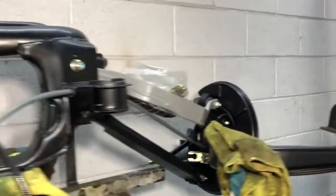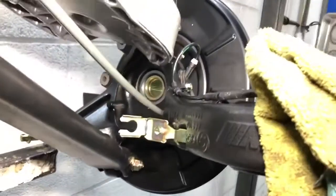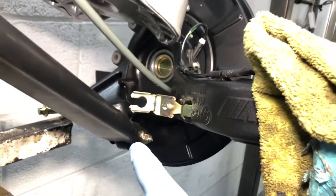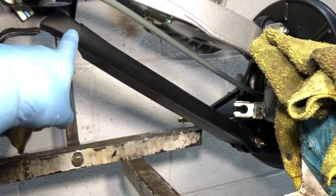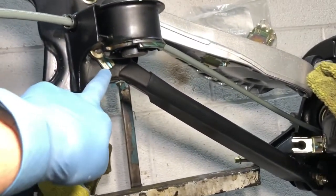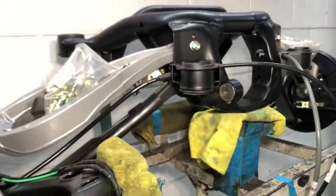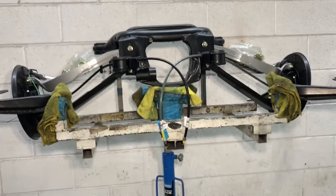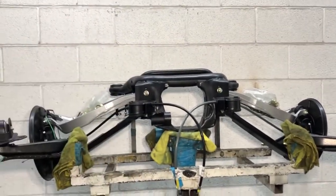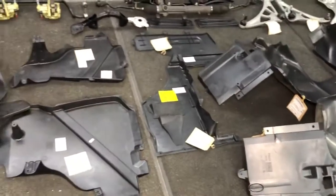It's pretty much the same affair on the other side, so it's all looking fresh and new. Looking down from this angle you can see the brackets for the brake flexi pipe, the lower camber bolts, and the eccentric system — all new — as are the lower arms, including the special little lock tabs, nuts and bolts which are all zinced and protected. That's the axle being prepared; we're putting the differential in soon, then the whole axle assembly goes back up on our hydraulic jig system. We build them on a frame and that's how we take them out of the car as well.